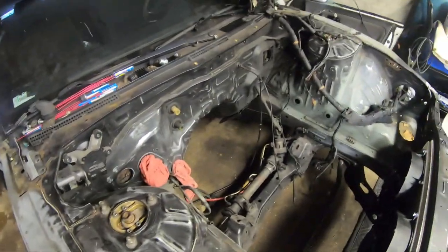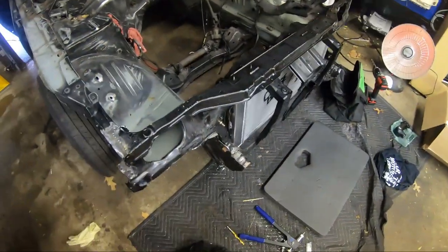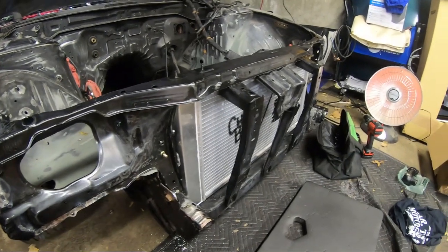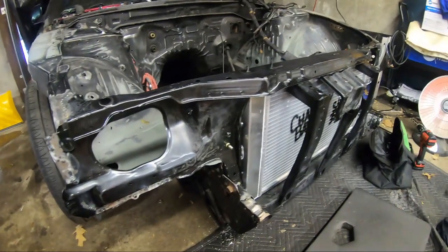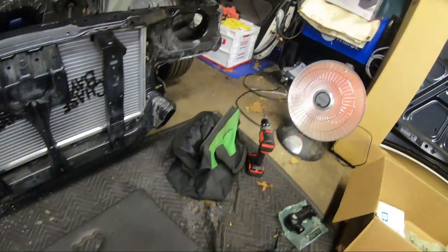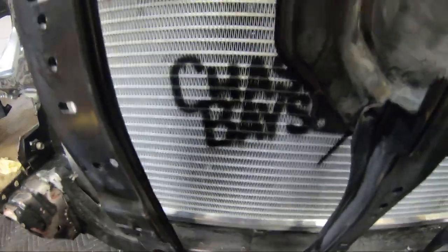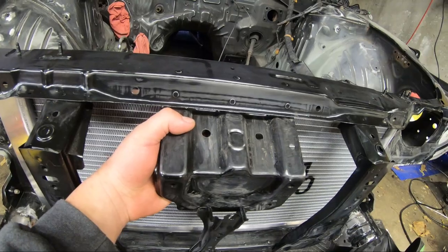The next big thing was the radiator support — that's actually welded in now, it's solid. Checked it with a level and it's pretty solid, so that's all welded in and ready to go. That was another big step. Last weekend I cut the radiator support to fit the Chase Bays tucked radiator, which you can see here — had to cut here and had to cut here so it slides in.